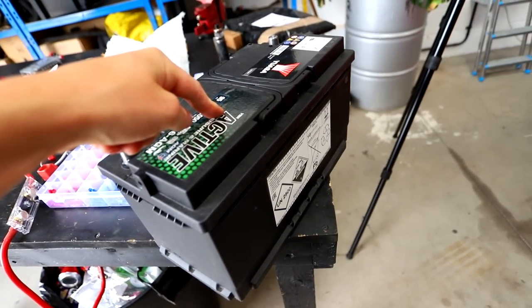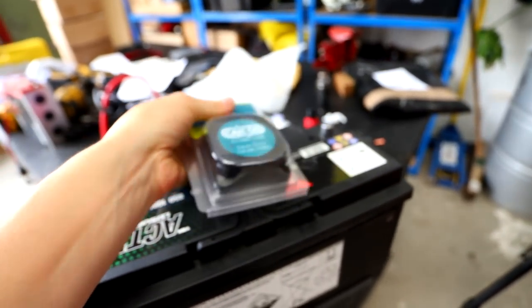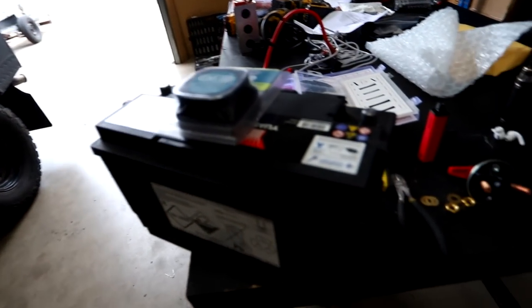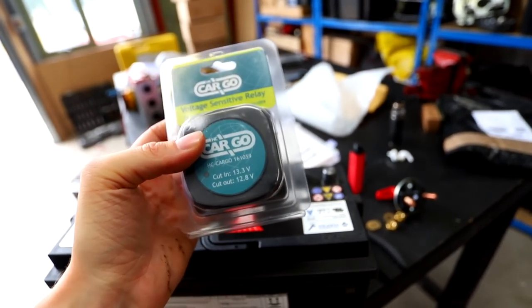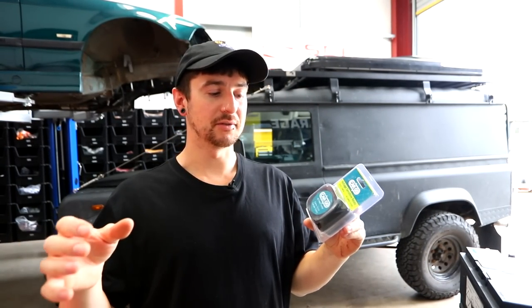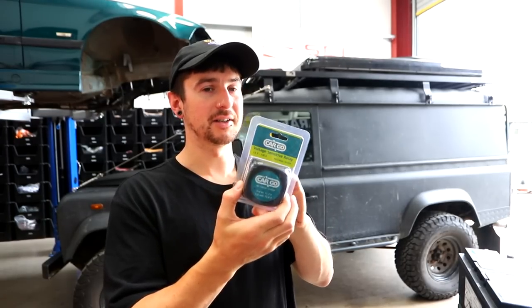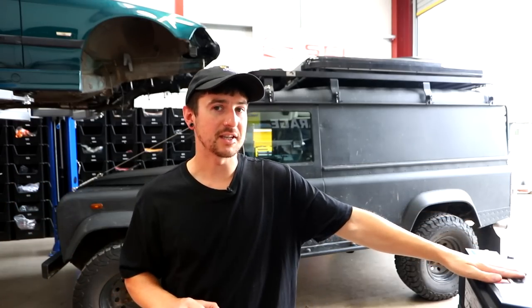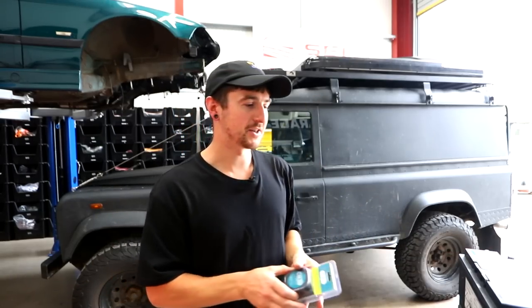If we just plunk this battery in and wire it up to all our stuff — our lights, fridge, chargers — we're just going to kill this one as well. So we need a way of charging it through the alternator, and the way I've got that is one of these: a split charge relay. This is a 2003, so it's got a normal alternator. Later more modern stuff has a smart alternator where the voltage varies and these don't work — you'd need a more expensive system. But because mine's old I can just use this, which was like 60 quid for the whole kit. It's literally just a relay: when you turn your car on the voltage rises because your alternator puts out a higher voltage, so when it senses the high voltage it cuts in. When you turn your car off, voltage drops, this cuts out, and that isolates the second battery. Charges when you're driving, shuts off when you're not — you'll never kill your starter battery.